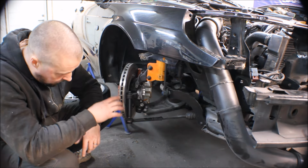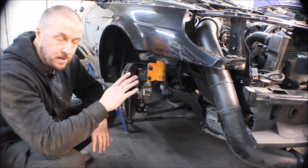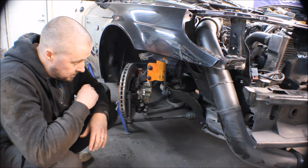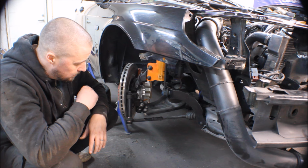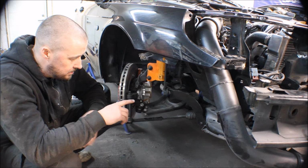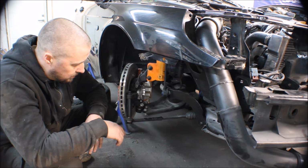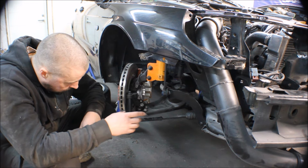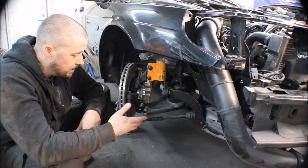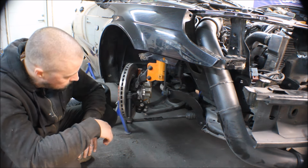You could definitely hear a lot of fluid being transferred, and it bubbles in the container. That must mean that it sort of works. So I guess now it's time to start up the car and see if it's actually helping out and making the steering wheel a lot looser. And you could also hear that it's making some noises, because the steering rack has been emptied out completely of oil, so it needs to be lubed up again.